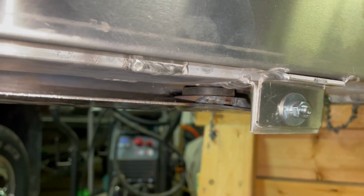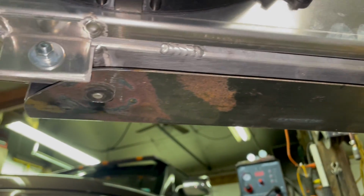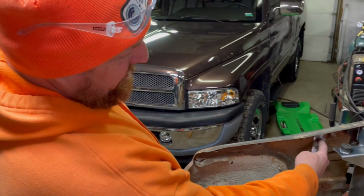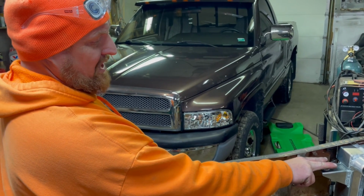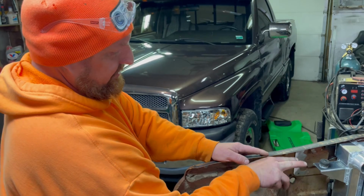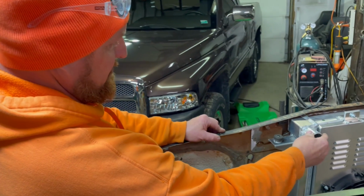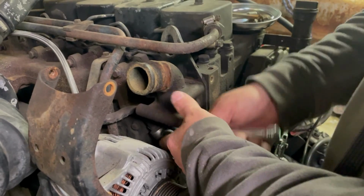It's hard to see, but this is the bottom of the radiator. It has this plate here that it's bolting, the radiator to the core support, to attach it all together. Two tabs on here come out of here, and I'm going to have a piece that comes out and goes on top of that to push down on all that to keep everything solid. It'll have two bolts going through here with adjustment on it, so you can smash that down and pinch everything together so it doesn't move and keeps it away from the support.